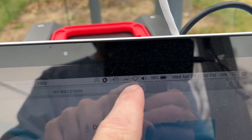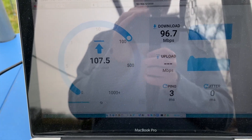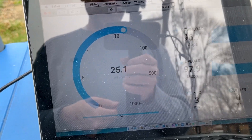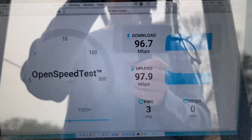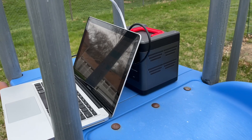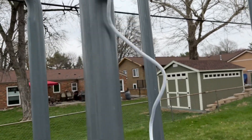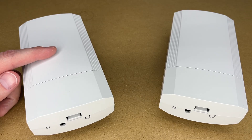I'm plugged into ethernet and my Wi-Fi is not connected. Running the speed test outside, we're getting just under 100 megabits per second up and download. If you were in a garage wanting to watch Netflix, YouTube, or Amazon, this would easily handle that stream, and security cameras would be no problem either. The unit can also act as a wireless hotspot — by default it's enabled on the master but not the slave, and the manual explains how to set that up, which can really extend your range.